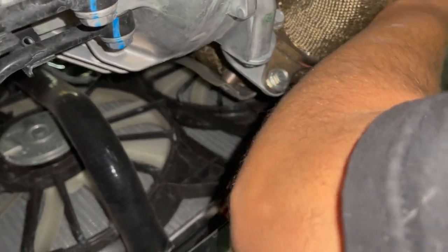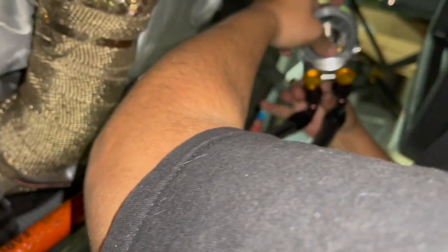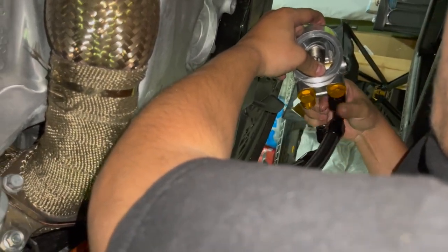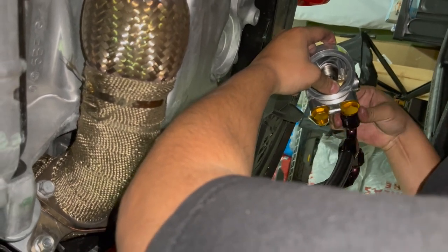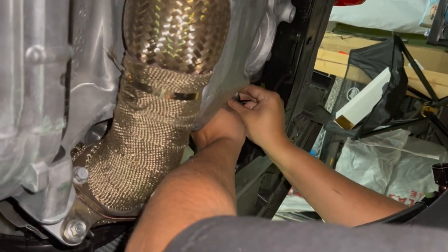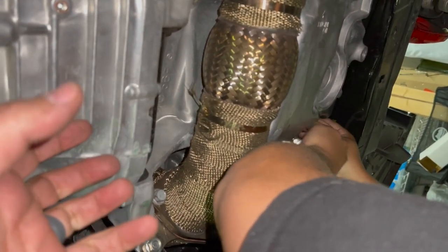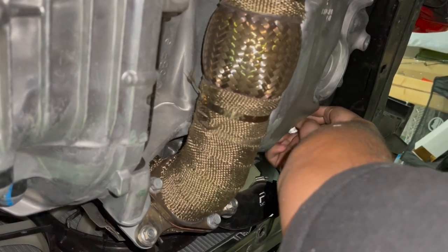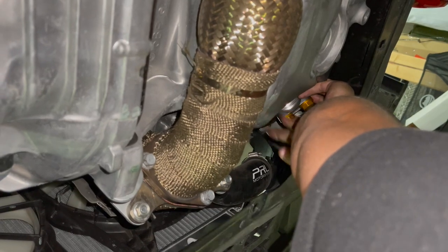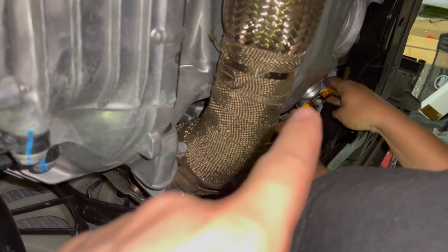There's the sandwich plate he's working on. We also tested out the oil filter — Greddy's instructions say you need to use their oil filter. I think the Greddy oil filter is smaller, similar to the HKS oil filters from back in the 90s for the B16s. By being smaller, they may create a little more oil pressure, which helps VTEC. Now I don't think it's necessary — time will tell. On the sandwich plate there are two nuts: you can use those ports for oil pressure and oil temperature sensors. Greddy's picture shows those sensors installed, but we're not going to run them.